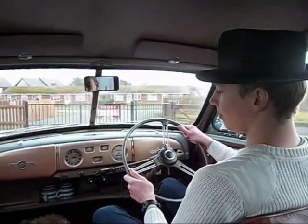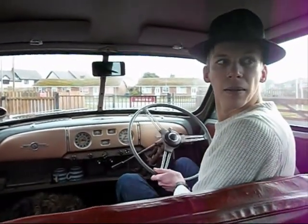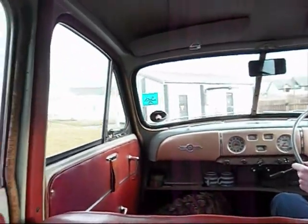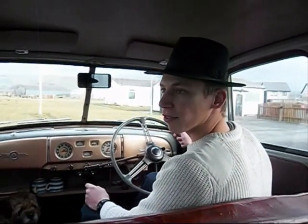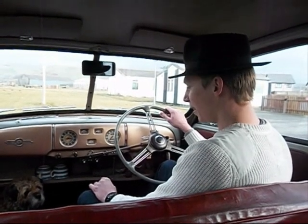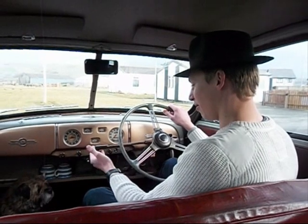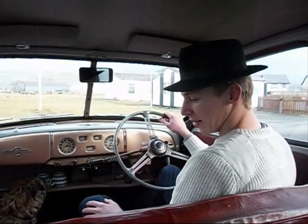To neutral. The controls are really feather light. The linkage is adjustable on these cars — Morris Oxfords — it has adjustable ball joints beneath the floorboard. I prefer a column change; it is a smart feature, and of course it enables three-abreast seating in the front.